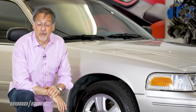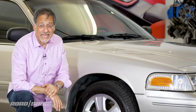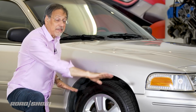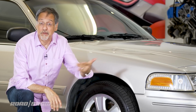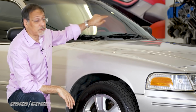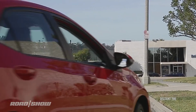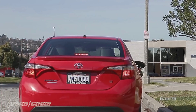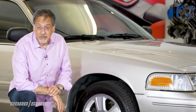First thing is to get your car in the right place. Where it got a flat and you came to a stop is not necessarily that place. You want to be somewhere flat, like we are right now. If you have to, limp your car slowly to such a place. And you want to be out of traffic, especially if you're changing a tire over on that side, which is the traffic side if you're on the side of the road. Don't hang your ass out where the traffic is. Pull the car over, or if you're working on this side, you're in better shape.